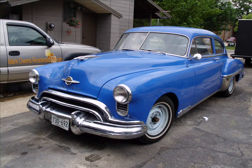I want to add also there's no smoke or excessive blow-by on the engine. It seems like it has pretty good compression. It's original running gear, 6-volt ignition system, original brake system. Essentially, it's just like a 1949 car off the assembly line, just with repairs over the years and maintenance done to it.